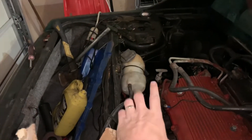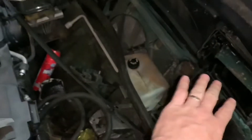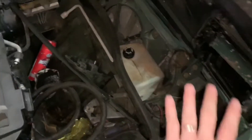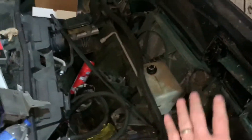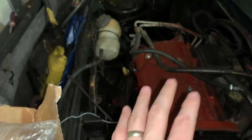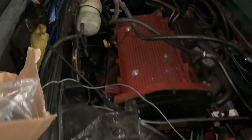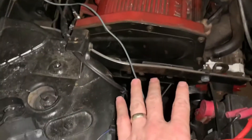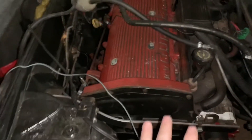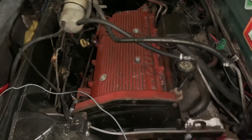So that's going to be a high side on this side, and the front side is going to be the higher side there. We just need access on both sides so we don't have any air pockets — air pockets are what blow motors, ask me how I know. We just want this whole system to be bleedable and as safe as possible for the Quad Four. This is kind of a high-tolerance motor put in by me, which means it is low-tolerant to my bullshit.